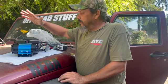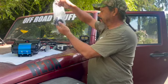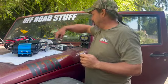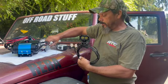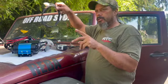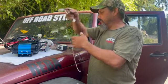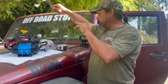Real quick, I just want to give you guys a little rundown on it. Obviously it looks identical. It comes with two little filters that go on the inlet side, a couple of bolts for the underneath mounting, and a couple of wiring harnesses. One is the main harness — pretty self-explanatory. There's another one that plugs into a three-port connector, and I believe this one goes to your solenoids if you're running air lockers. Then there's another one that goes to rocker switches so you can control everything. Since we don't have air lockers, we're not using that — well, there's a section of it we do need, we'll get into that later.